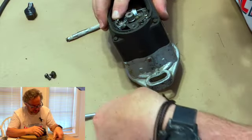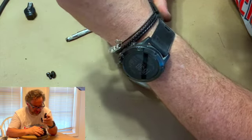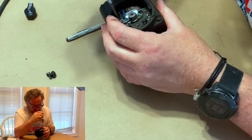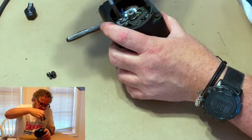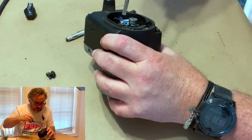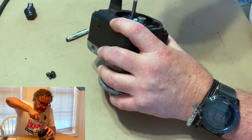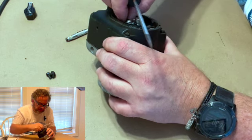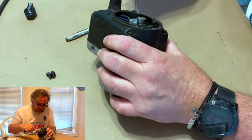But basically what I'm doing is just getting those three wires together, putting the screw on there, tightening it up, because this is in that little nylon block. So this has some inherent drag on the screw. If it's loose, you're going to probably want to get another block, which you can take the one out of the old one, or you can even take a little heat shrink or something like that, some kind of plastic, and sort of fill the hole in.